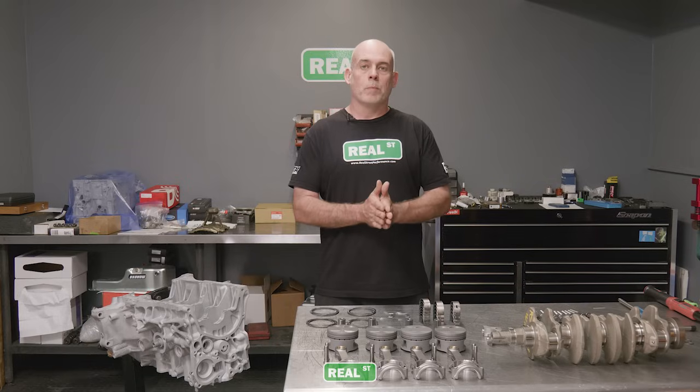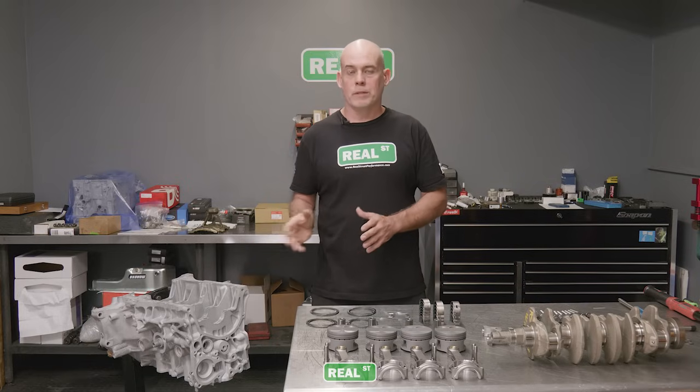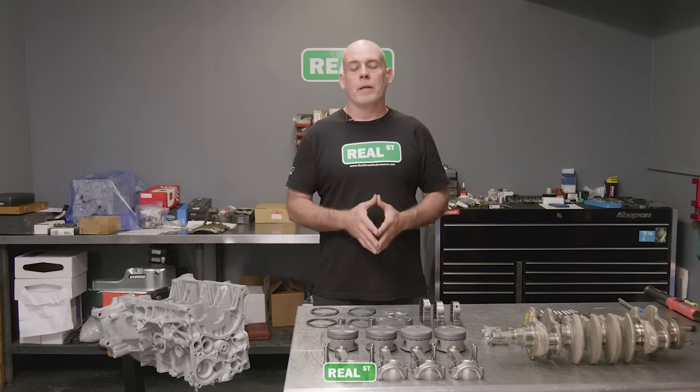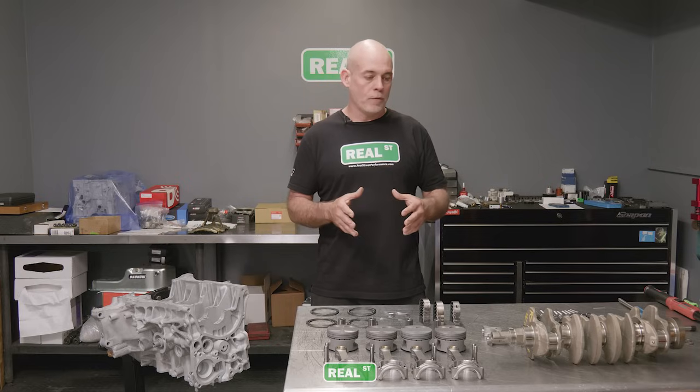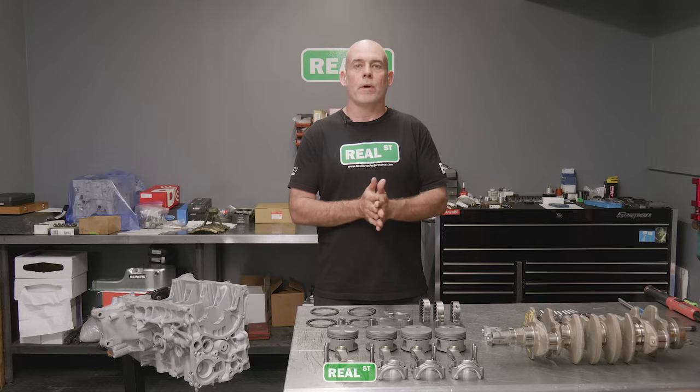If you're taking larger blocks of time between this step and, say, the actual assembly process, you have to keep in mind that corrosion is a problem. So if you're gonna put all these parts away and not touch them for another week, I would use some sort of light oil like WD-40 on the bare metal. I would store the components in air conditioning where the air should be a bit drier. But you just wanna be mindful that best case scenario, you get everything clean, dry, and put it together right then. That'll give you your highest chance of success as far as keeping foreign material out of the engine.